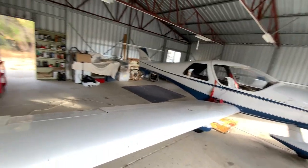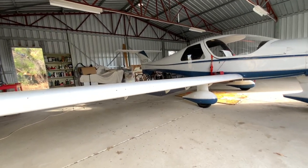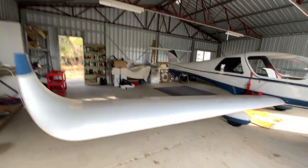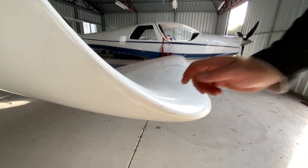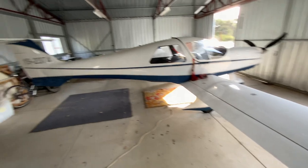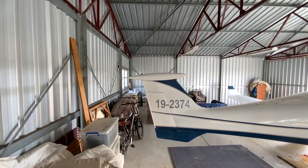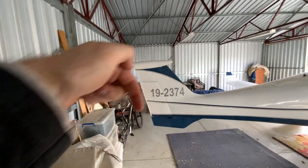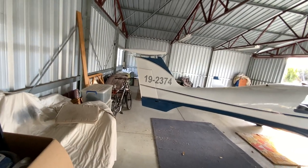I'll give you a shot of the wing here — you can see it's quite a thin wing. It does have a fairly thick chord but it's a very high-speed airfoil. It's not quite a laminar foil because you can see the thickest part of the chord is quite far forward on the wing, but it definitely is a high-speed airfoil and you can see that from the tail as well. It's basically almost a symmetrical airfoil, but like a standard T-tail it's got an inverted airfoil, so you've got some downward force on the tail.